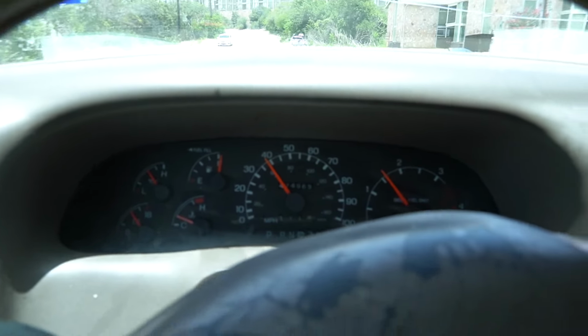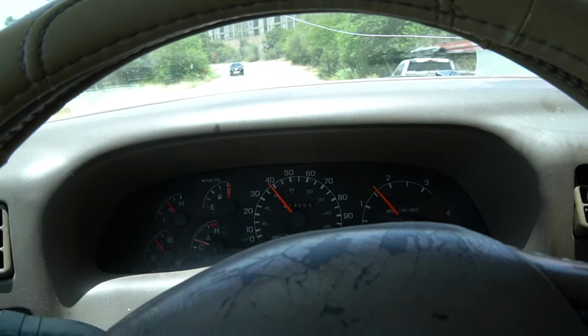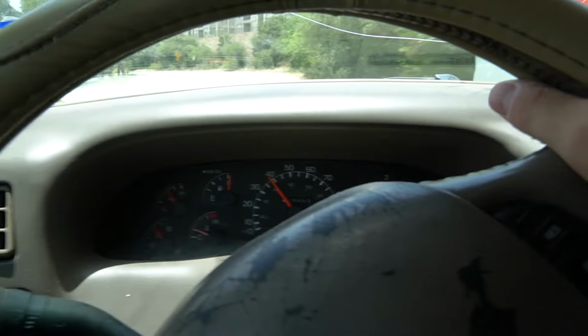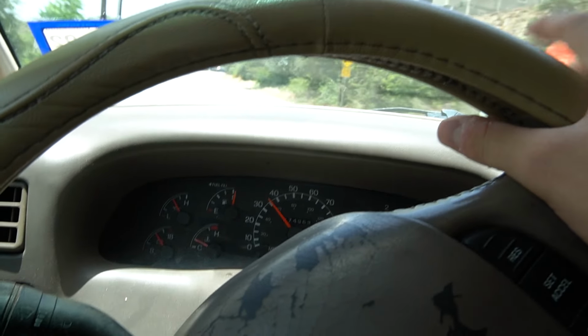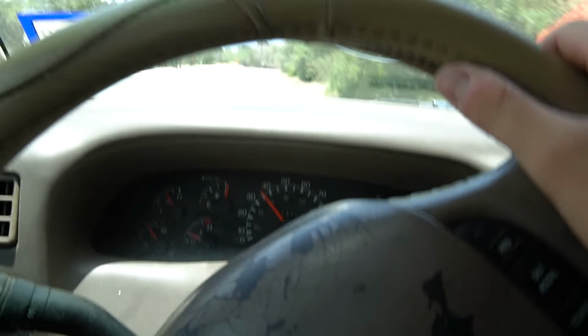If you try to burn it in four-wheel drive, you're going to be turning twice the weight as well, so you're going to be burning a lot more fuel, and it's going to be a lot more taxing on your engine if you want to try to put it in four-wheel drive to get out of somewhere, or even, sometimes people even put it in four-wheel drive to race somebody. Right now, I'm currently driving around with this guy in four-wheel drive. I'm going about 40 miles an hour in the four high mode. Now, once again, guys, like I said, I do recommend keeping it in this drive mode if you're trying to get up a hill or up an icy slope, or even in the sandy area, if you're trying to spin your tires really fast.